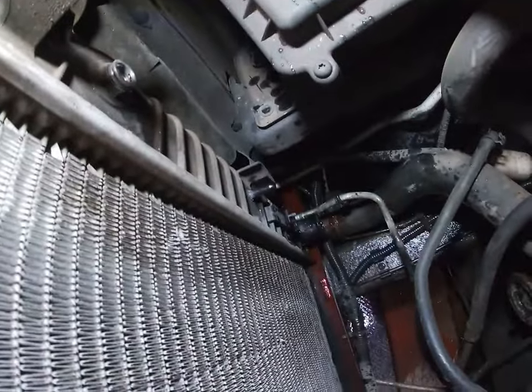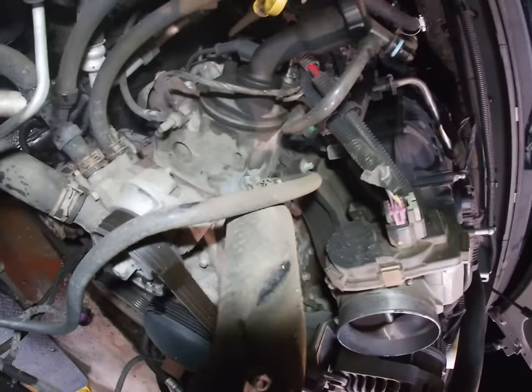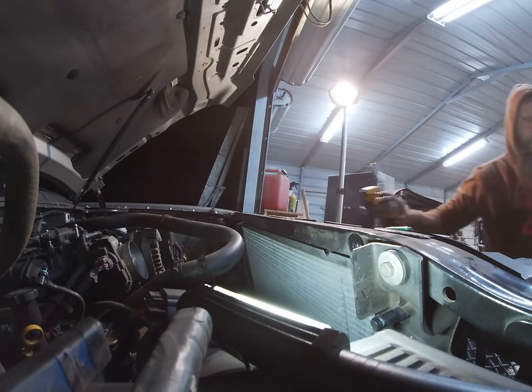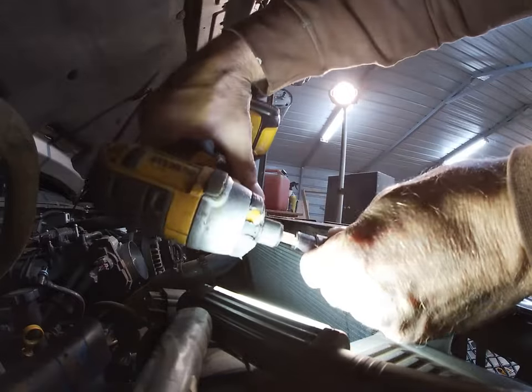Recapped, we just took off the bottom radiator hose, the hose that goes back to the head, that's like just a little, I think, breathing port, and the overflow hose, the other oil line here, and then the two, I'm sorry, transmission lines, oil lines on that side, and I think that's it. Let's unbolt her and take her out of there. All these on a Tahoe and about all the way up, because my 1999 Silverado 2500, and this is all 13 millimeter.